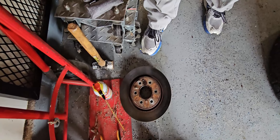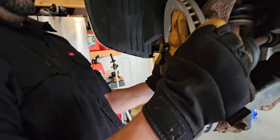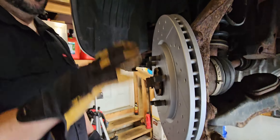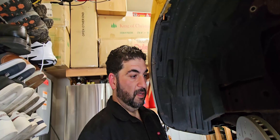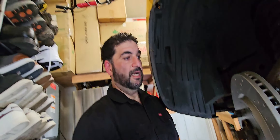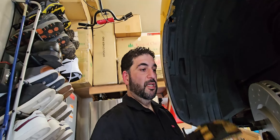It's a beautiful brake. Now we've got the new one — these are slotted rotors with holes. When you get your brake rotors, make sure you spray them with brake cleaner, because most of them come with oil all over them and you want to get that off. I already did that, so it's already been cleaned with brake cleaner.